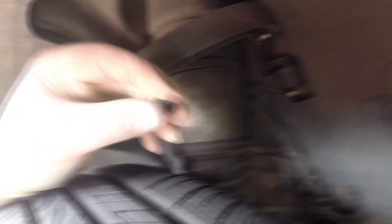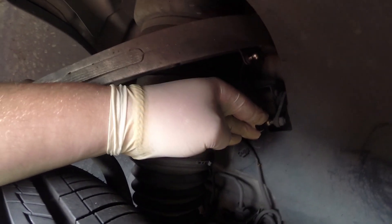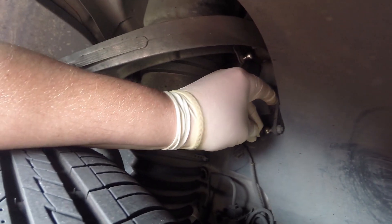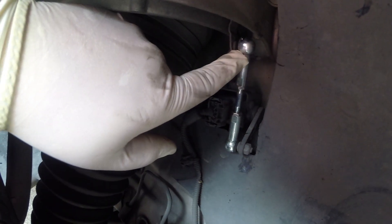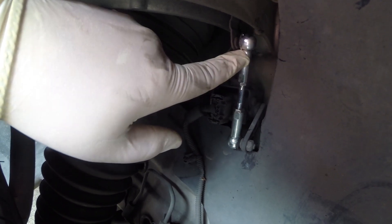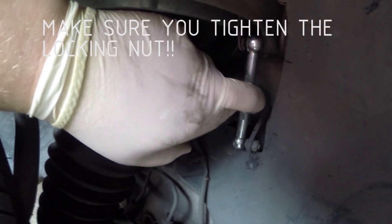What we want to do here is fit the rubber grommet onto the ball, like that, so it seals the connection. You've got a rubber grommet there and rubber grommet up there, and the ball will come on and it'll be a fairly good seal. Put some grease on the end. With a bit of a push they pop on — remove the little pins first, then install them to make it easier. They pop on, clip on, then you pop your pins in and it's on there secure.